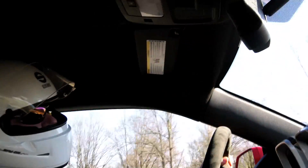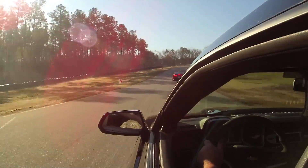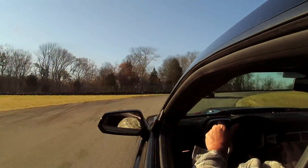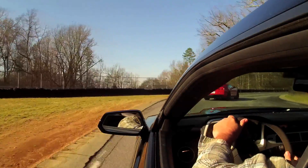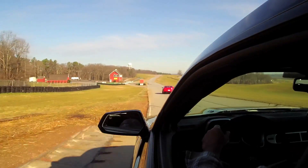What's the hot ticket for launching this car at the drag strip? For launching this car at the drag strip, Mode 4 PTM has launch control enabled and it's tuned for these Goodyear tires on the street. You go into Mode 4, full throttle, and it holds the RPM that it calculates it needs — it looks at ambient temperature and other things and says it's somewhere between 3,000 and 4,000 RPM. You do a moderate release on the clutch — not sidestep the clutch and not feathering or slipping the clutch — and it'll maximize the wheel slip for forward momentum. It works great and it's very repeatable on the drag strip.